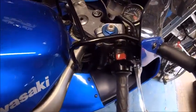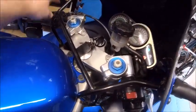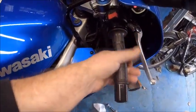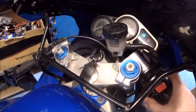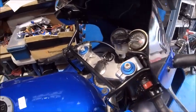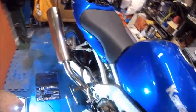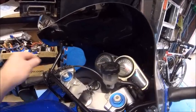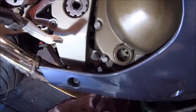Let's try and gas myself out with this bike. This truly is a first start. Lovely — alarm off. Everything on, switch the lights off, choke on full, a couple of blips on the throttle because it's a carb model and there won't be much fuel in the carbs — then we hit the go button. That should be enough now to get the oil pressure up. I'll give it a minute for the oil to settle back down.